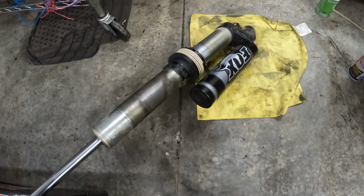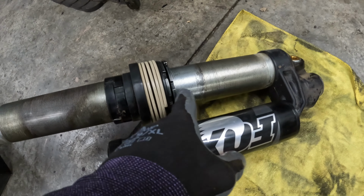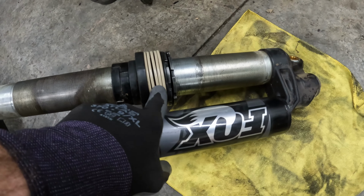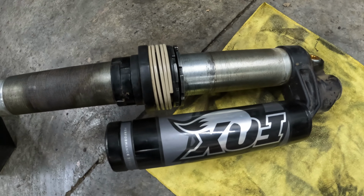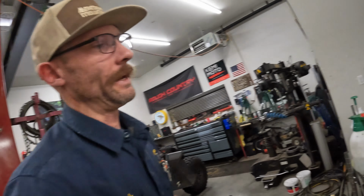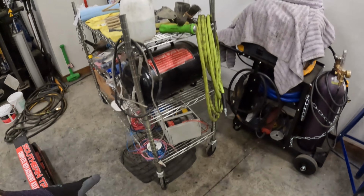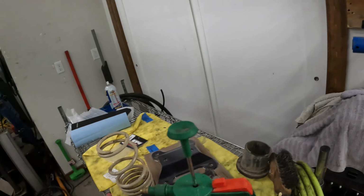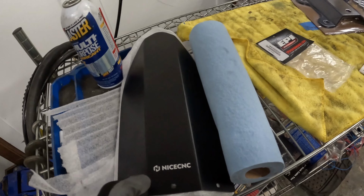Huh, yeah, wow. Lowrider. And I've got one of the rear shocks off here. You can see the vehicle is sitting really low after making it 72 inches wide. If you're trying to adjust it, I made the adjustment here. You're really just squishing down that little dampener spring that doesn't really adjust the ride height. So I've got the main spring and the spring compressor here. I was able to relieve the main spring retainer off the bottom here. And while I'm there, I'm gonna put on these nice CNC aluminum powder coated covers.